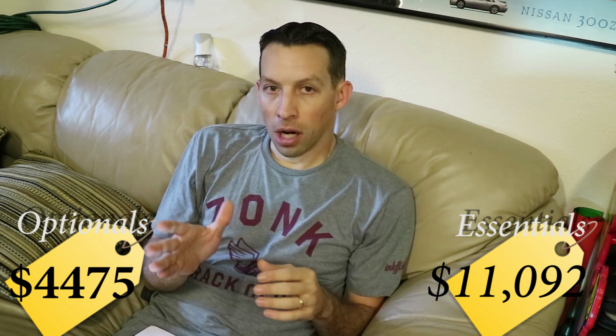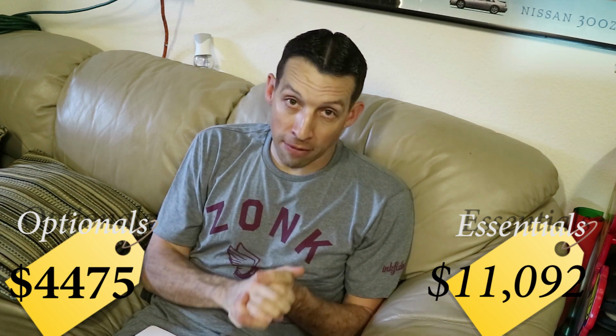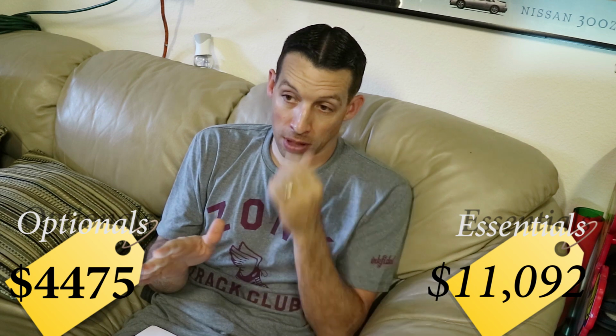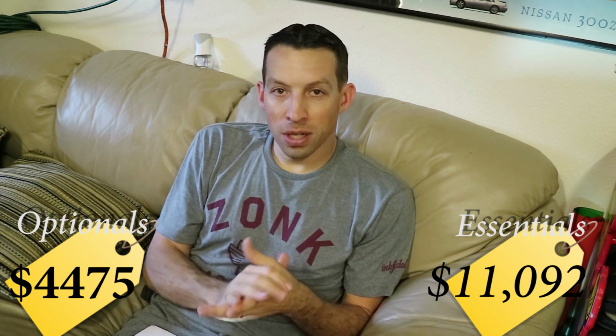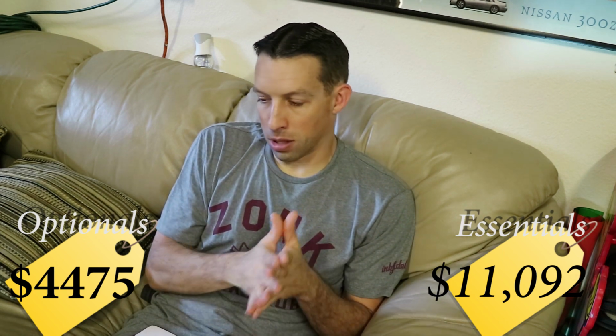The engine comes with an ECU. You can use that ECU, but you're going to have to use MAFs, and you're going to have to use RB26 MAFs, unless the ECU's been reprogrammed to use Z32 MAFs. But the engine doesn't come with MAFs. So you're going to have to source those. So those are additional costs.